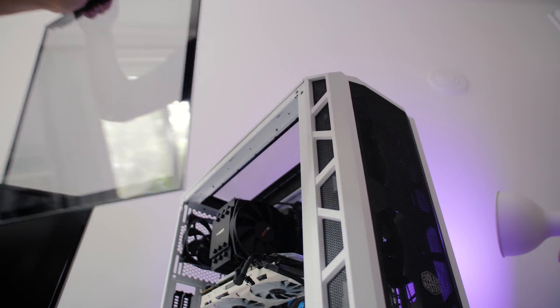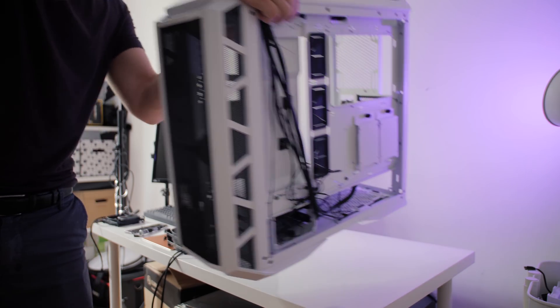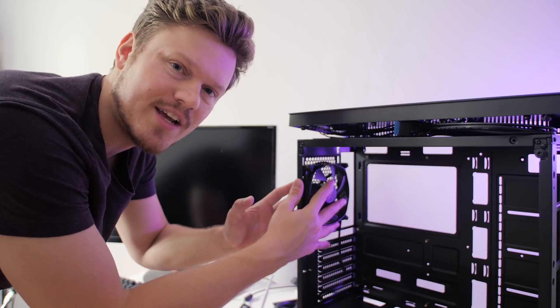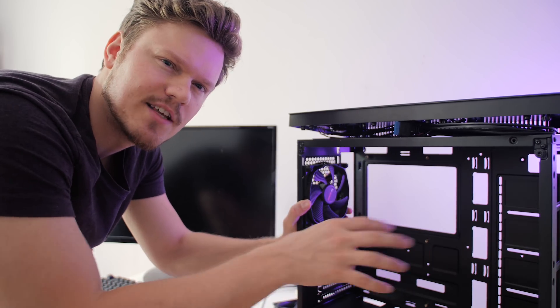I cannot hear anything while the system is at load — that is the power of air cooling. The reason I'm not reversing airflow inside the H500P mesh is because the front panel is already non-restrictive, so there's no reason to combat the poor air you might expect from a completely closed front panel. Starting with the cheaper case, the front panel is basically completely closed aside from tiny ventilation. If my hypothesis is correct, we'll get more fresh intake from the rear so the CPU will be cooler, and then we'll see what happens when exhausting through the front.